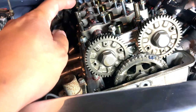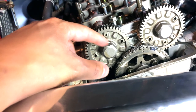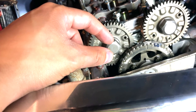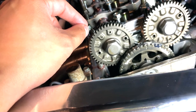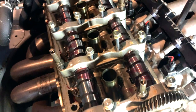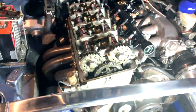Some time has passed. They ended up using the stock cam gears instead of the Skunk 2 ones, because in the middle where that little pin goes, one of the Skunk 2 cam gears wouldn't slide on — it's like I'd have to grind down a little lip or something, and just didn't feel like doing that. Probably just going to send them back or toss them on the shelf for another time. We got it all lubed up with the assembly lube, just going to torque these down, throw it all back together. Might get a start-up tonight — let's hope so.